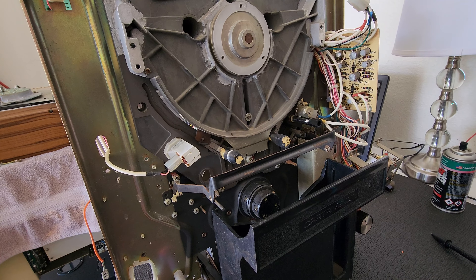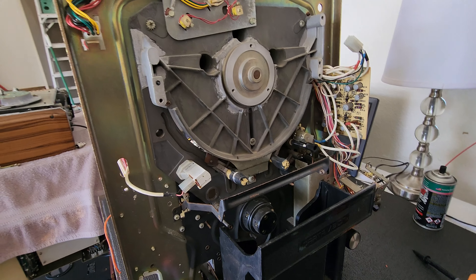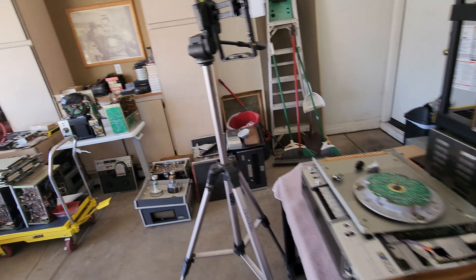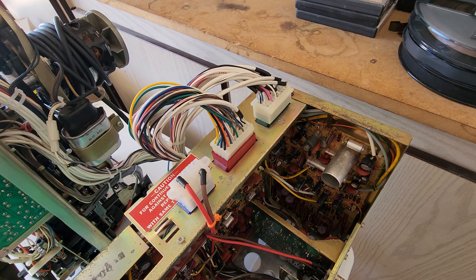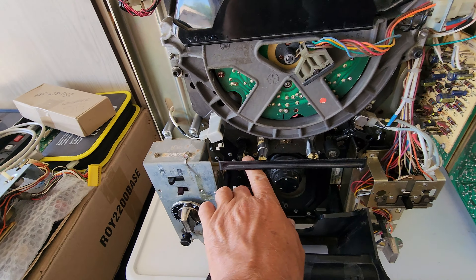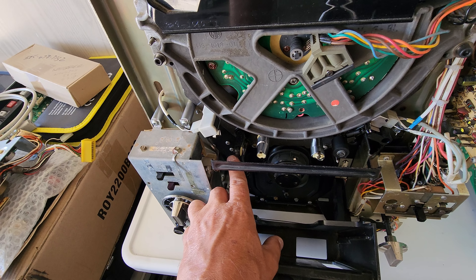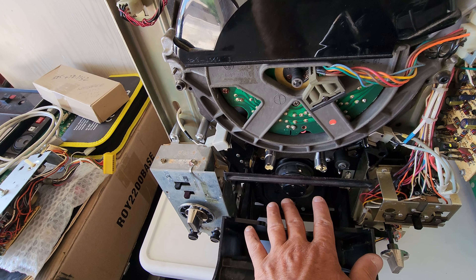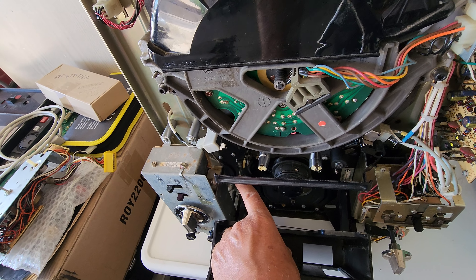Except for the one that I rebuilt over the past two and a half years. Here's another common problem — I'm pretty sure I've got this figured out. I did all the plugs on this unit and here's my unit all together, with all the new plugs put in place. But inside you have what's called a photo sensor. It senses and turns on and off with light, which would tell the system when you turn your knob that it should want to load. I've got a funny feeling we've got a bad photo sensor right here.